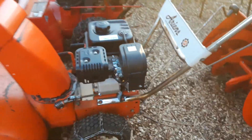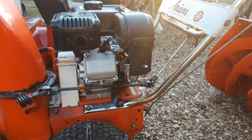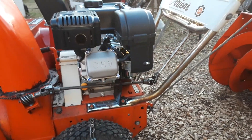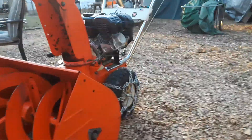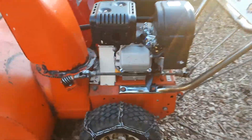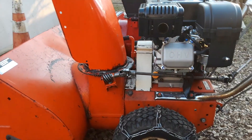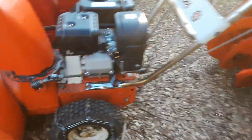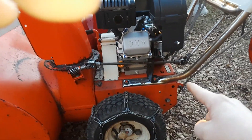These are excellent for anything 4000 RPM and under. Once you start reaching 4100, 4200 RPM — I run my Hemi on this machine at 4400 RPM and the non-Hemi around the same — it still winds a little bit. But as soon as you put the machine under a load, or if I turn on the auger, it smooths right out.